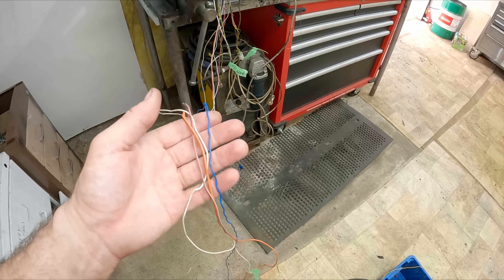I'm pretty pedantic with labeling stuff. FC is fuel control, ECU 12 volts, ground, injector, ignition as well. I'm just going to cut them off and make these connections on here. These are just little crimps that come with the plug — you can just buy these plugs, they're AMP plugs, 34 pin. I've just got to strip back some of these wire ends and put those connections on, then put them into the appropriate slot in the ECU pins.